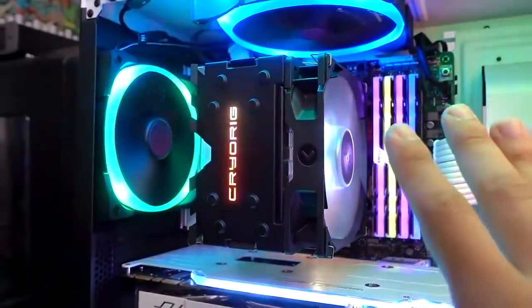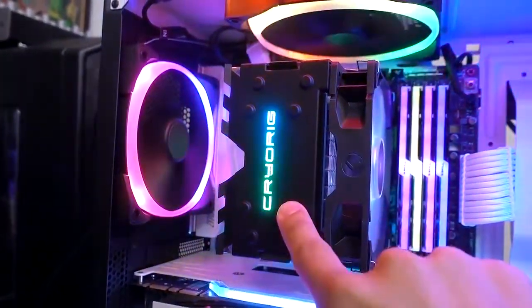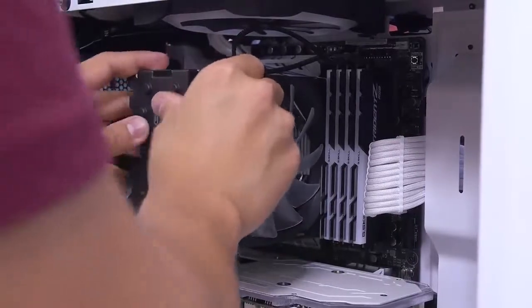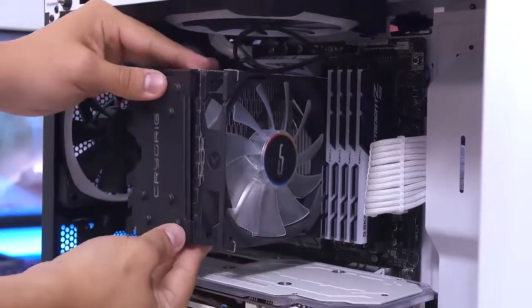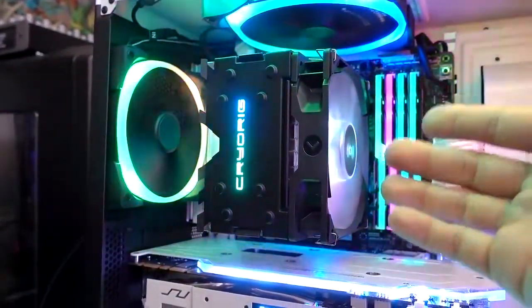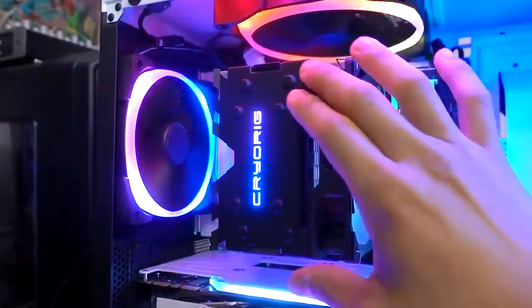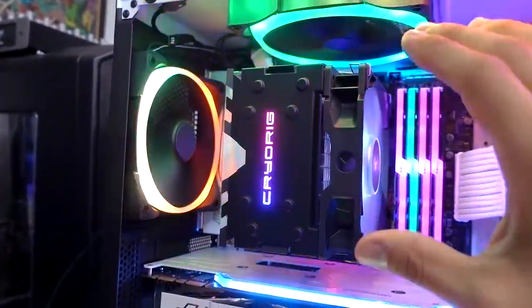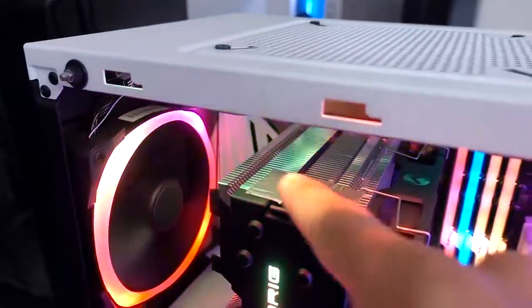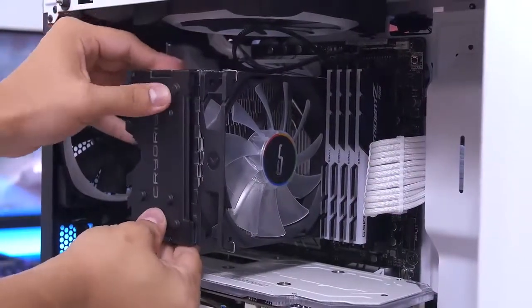Now I must confess, there was a not-so-great experience with this cooler in regards to the faceplate. It's a plastic faceplate that just attaches to the heatsink via four small plastic tabs — really tiny little plastic latches that insert into a couple holes in the heatsink itself. Two of those latches broke off in the midst of me trying to mount this cooler to the motherboard, with what I would not consider any sort of excessive force. I don't know if this is a final retail version — I got this straight from CryoRig at their Computex booth long before launch — so I don't know if they're going to be using the same design and same plastic tabs. But in the event that they are, just be very careful with this faceplate. I've actually resorted to using a piece of duct tape to hold this plate in position, because without it, the remaining two plastic latches on the bottom aren't enough to hold the cooler in place.